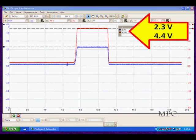You say, how do we try to find out what's wrong? We start off by looking at lab scopes. Here we're looking at a lab scope showing us two sensors — one ends at 2.3 volts, that's the blue trace, and the red trace goes up to 4.4. In this particular vehicle, they're both normal.